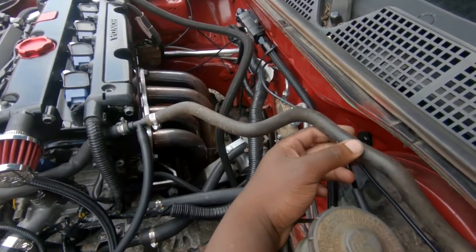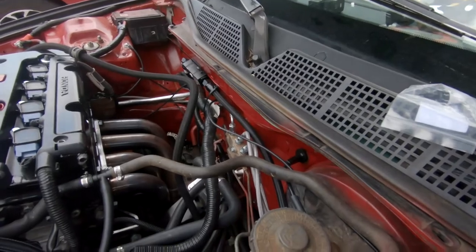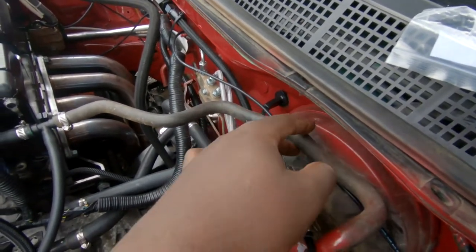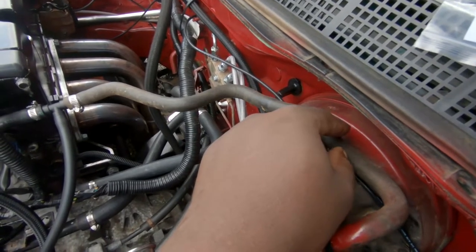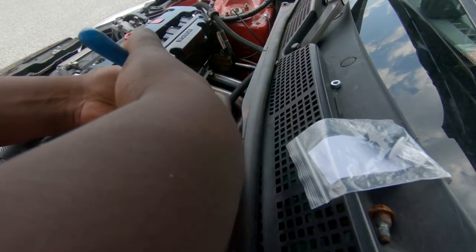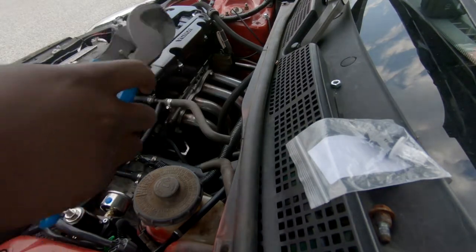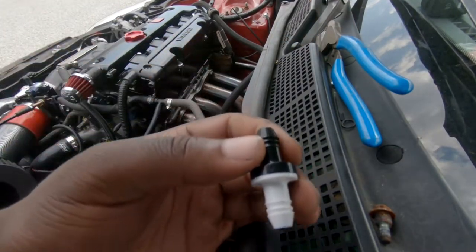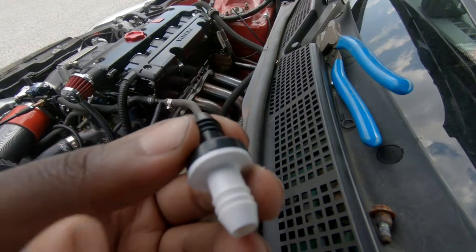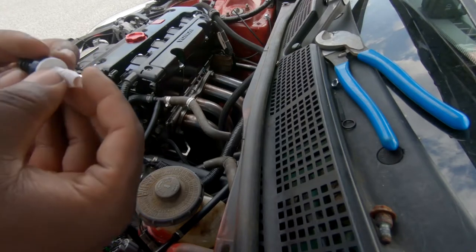There's something pretty solid down there I don't recognize. Anyway, we're gonna make a little splice in this line somewhere. These cutters are meant for hose and they work really well. There's a little arrow on the check valve — I think that means it goes towards the intake manifold, so we'll do that. I'm going to hose-clamp this just to be safe.